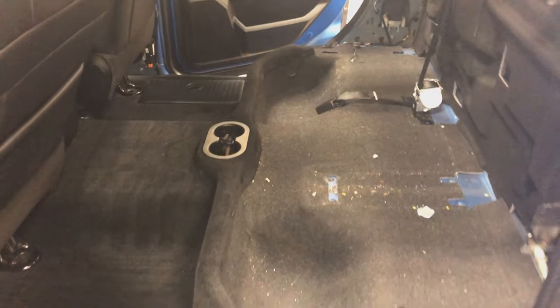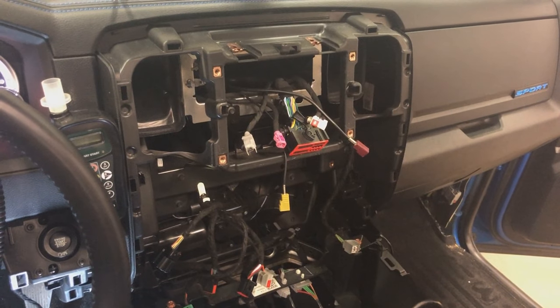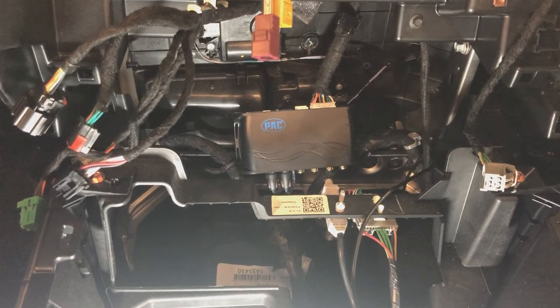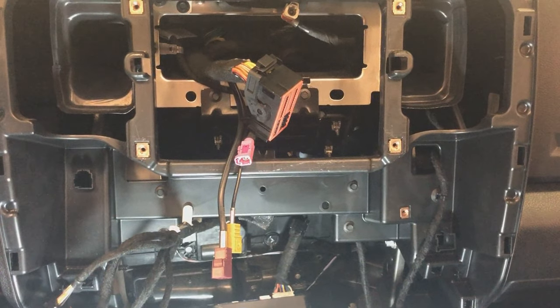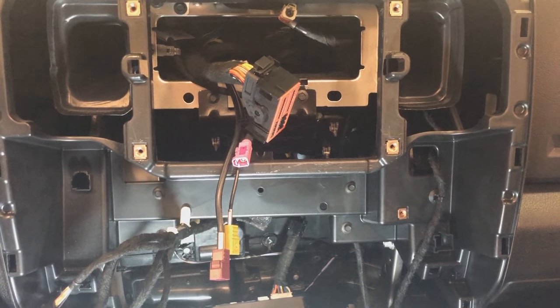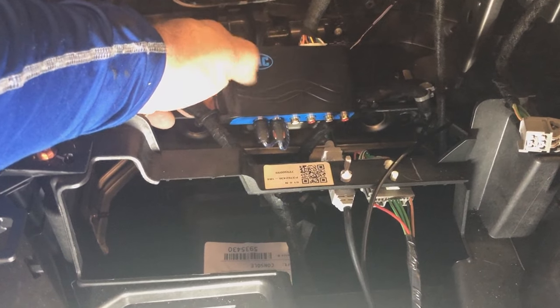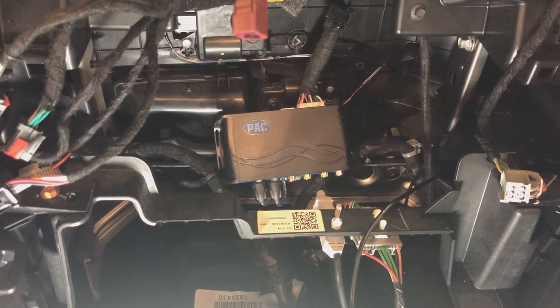Now we have a clean slate. All of the aftermarket wiring has been removed — power wire gone, high levels gone, every ounce of wiring removed from this vehicle. Now we start the rebuild with signal. We have our AP4 plugged in, and this plugs back into the factory head unit. What this device does is take the non-variable voltage coming out of the factory head unit and turn it into a signal we can use, processed through the Tweak. We're only using one set of RCAs out of the AP4, running one signal back to the Tweak, then processing the signal into separate channels at the Tweak using the DSP software.